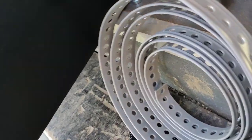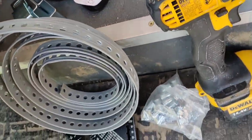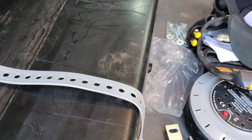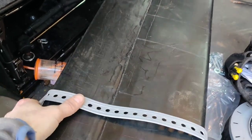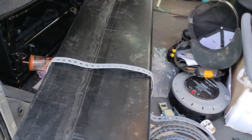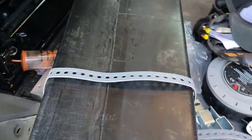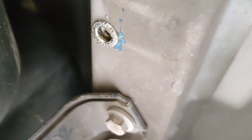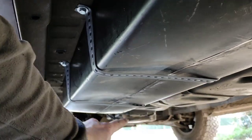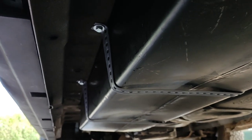Now I need to drop the tank out of the way and drill some holes to put some rivnuts in the frame, because that's how I'm going to attach this one. The kit for the grey water tank just comes with this flexible band that you have to bend and cut to shape. When I was under the van I marked out the height at which everything was going to sit. I'll bend it at the right point, cut it off, and do that twice. It doesn't look very tidy but once it tightens up that'll pull the kinks out. I'll make two of them and then get underneath and use them to mark out the positions for the holes for the rivnuts. Hopefully you can see the rivnuts I've added. Now we're going to push the tank up into place and do the straps up. Here's the tank bolted in place — this one wasn't too bad because the straps are more flexible, so it's easier to bolt up each side, put the tank in place, and then do the straps up.